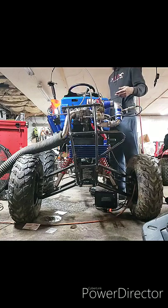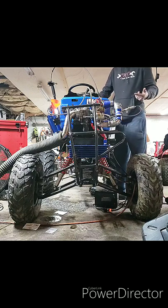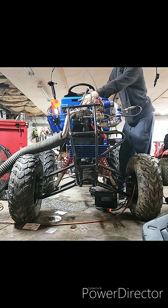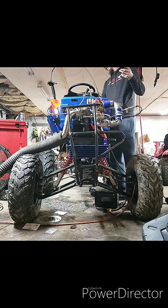We have a vacuum leak going on here, and the fuel pump was not running. Let me get the fuel pump running and plug this vacuum leak — I forgot I was keeping it open as a port in case I needed it for something. But right now I completely forgot about it, so let's try this again.